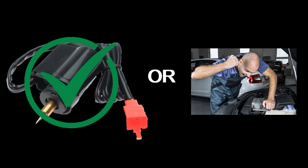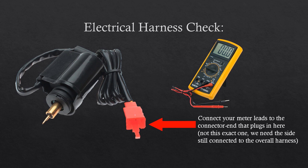If you do this test and the plunger extends and retracts as it should, then your engine issues are definitely not coming from the auto choke. Now if you determine your choke isn't working correctly, let's dive a little deeper into some troubleshooting. There are only two reasons for the choke to not be working properly: either the choke itself is bad, or there's some problem with the power going to it.